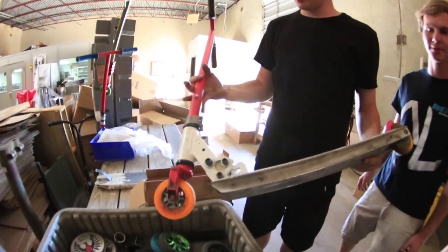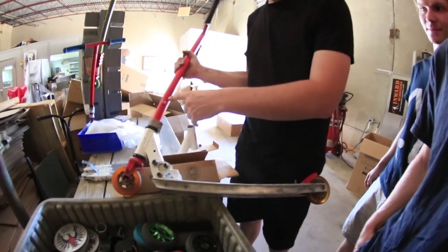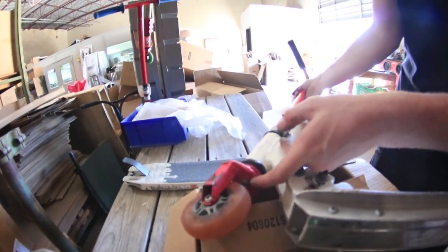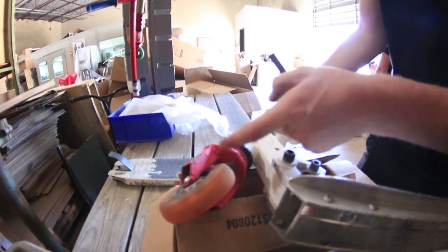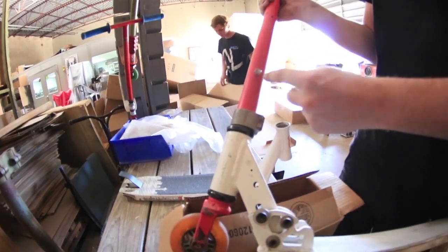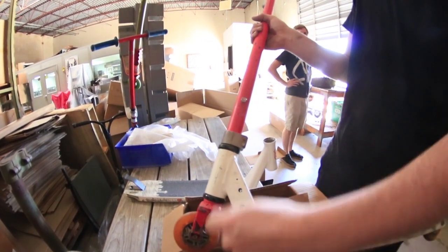Here's an old pro model complete from back in the day. They made their own compression system — there's a rod that goes from the bottom of the fork that a nut attaches to. There are threads on the rod, a nut goes on there, you tighten that nut, and a bolt goes through the rod with a little hook in it and it just pulls it down.